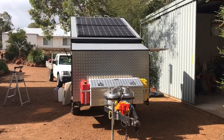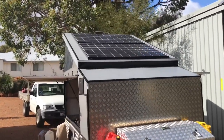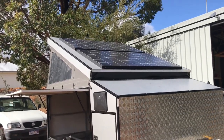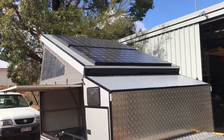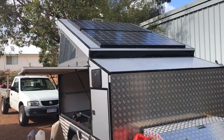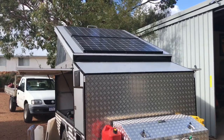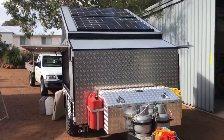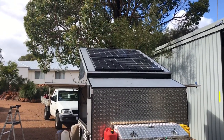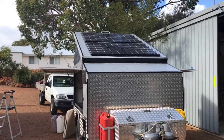On the outside looking up at the roof, we've got two solar panels mounted up there — 290-watt panels each, which is a huge amount of solar for a trailer this size. They feed the charge controller we've seen earlier and keep the two 150-amp AGM batteries topped up nicely. Whenever there's any level of sun, they convert that into a good charge. They're essentially household roof solar panels, and we're really happy with them.